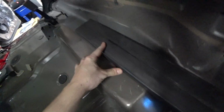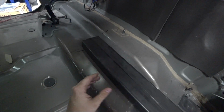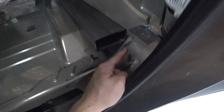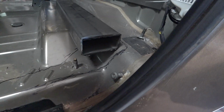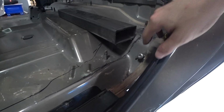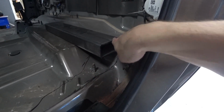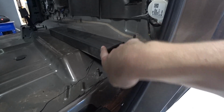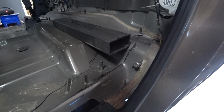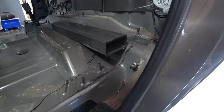What's the next step? Well, this fits really good in the back of this L-shaped corner here. The only problem is that this edge tends to drop off, and we don't need this bolt here or anything like that. So I think I'll take some of my steel and create a filler plate that connects from here to here to here, and fills this area. I'll take some cardboard, draw out what I need, and match it in cardboard, and that'll be our end plate.